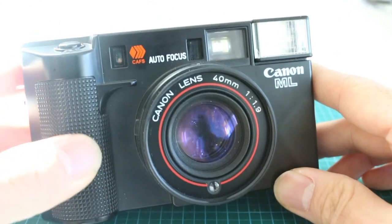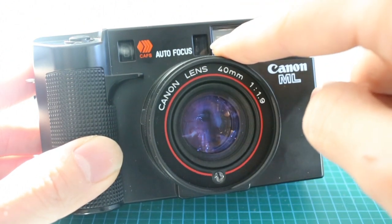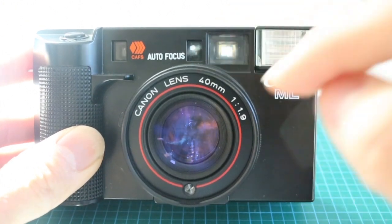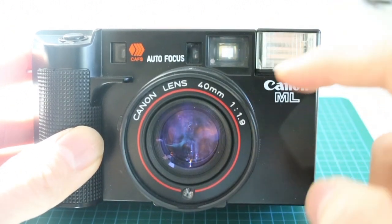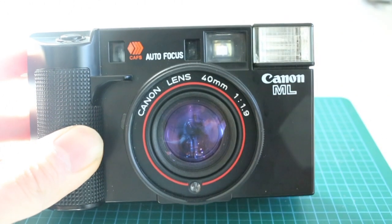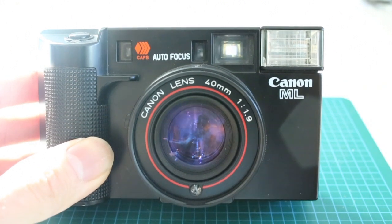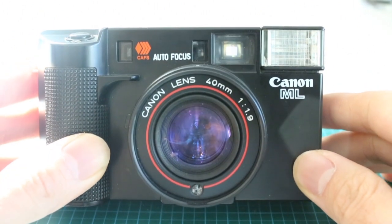To make a long explanation short, you can notice there are two windows here. Those two windows lead to two sensors inside, which are used to compare. One is according to the line of sight, situated just above the lens, and can determine what should be projected onto the film. The other uses effectively a mirror that determines how far away the subject is by moving, and can quickly determine if the image it's seeing matches by comparing the signals recorded on the charge coupling device. This is what's known as passive triangulation.